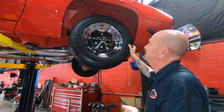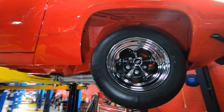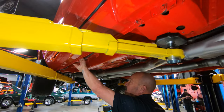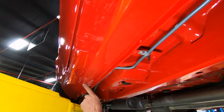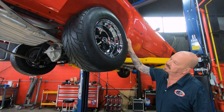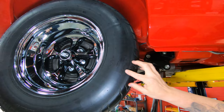And then we got Keystone Classics — I'd have given my left you-know-what to have these babies back in the day when I was a kid. Of course I couldn't afford them back then. We got 26 by 8 by 15 on the tire size. Look down the side of this baby — look how nice and clean it is. On every car you're buying, make sure you look at this pinch weld. Make sure you feel the back side of the rocker with your hand, and look at the bottom side of the rocker also. That cut right there is where the quarter panel ties into the rocker — every Mopar is like that. Up inside the wheelhouse, also got that same bed liner material, all painted body color. Out back here we got some Sticky Mickeys — 28 by 12 by 15s. Looking good.